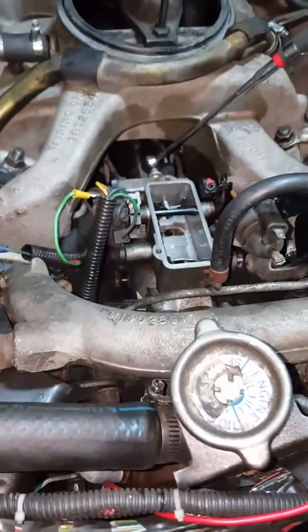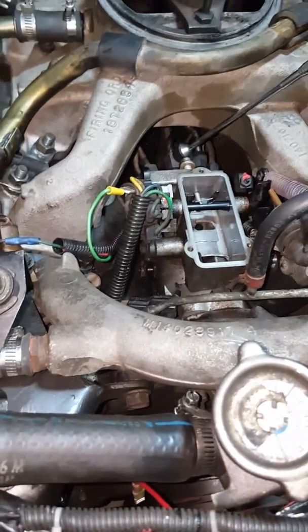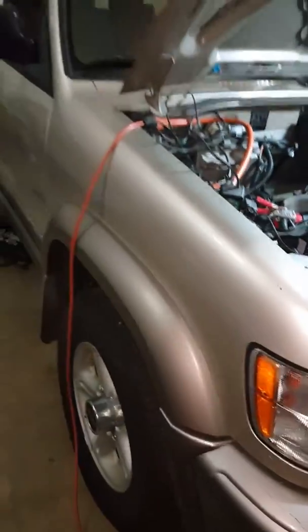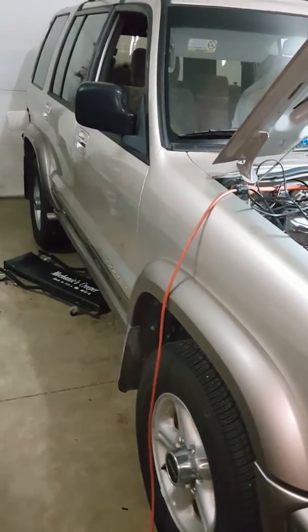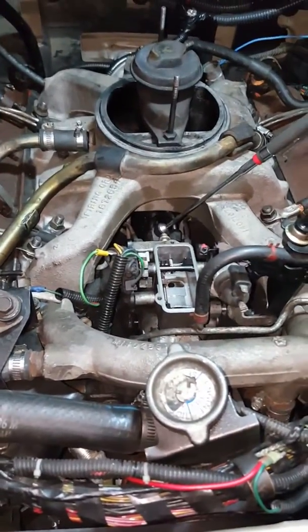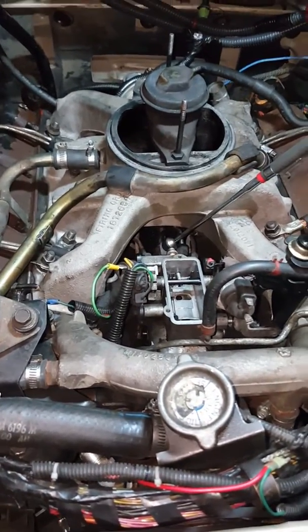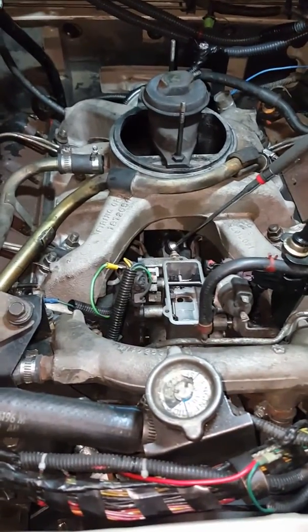Like I said, I'm hoping to achieve a little more torque up the hills, and less revving. So remember, this is inside of an Isuzu Trooper with the 430 gear, so it's 2,000 pounds less than the original application that this engine was in. The original application, the pickup, weighed about 7,200 pounds. We're at about 4,200, so maybe with this engine, we're at 4,500 pounds. So just under 2,000 pounds.